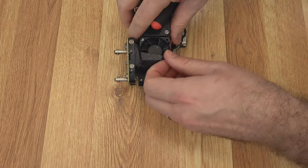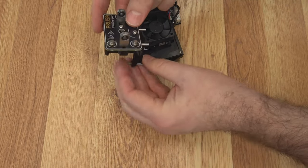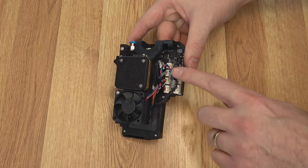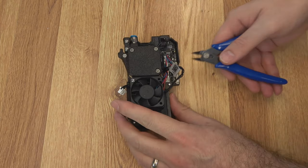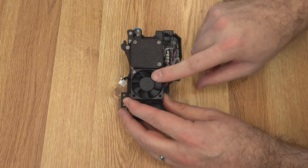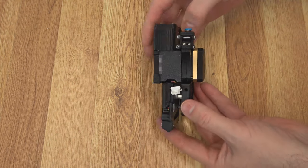There's no need to take the fan deflector off — just pull that screw and the whole dock will come loose. There is a PCB on this dock, but we can just unplug it — no need to disassemble the whole part. If you're going to take something like this apart, please take a picture and note where all the wires were before you get everything apart — make sure it goes back the same way. I'm going to remove this zip tie — we'll put it back. Since the hotend fan is here on top, we'll unplug it from this port and back out that one T10 Torx screw, then set the fan aside.